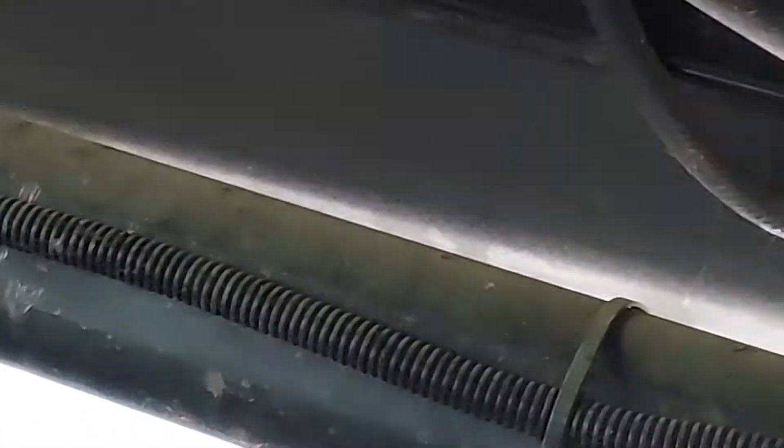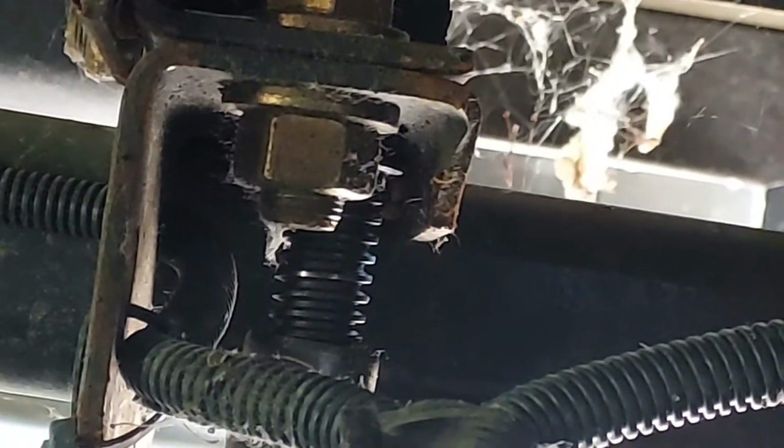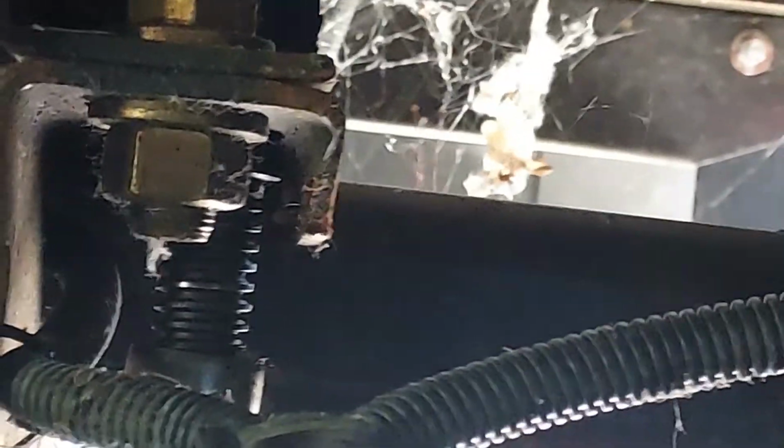So what you do not want to do is put it over here on the torsion bar that's going across. This is a torsion bar suspension system versus the leaf. So you want to jack your vehicle up on the side you're doing the grease on. Have the tire about 1 inch off the ground so you can free spin it.